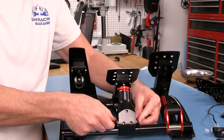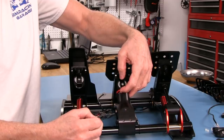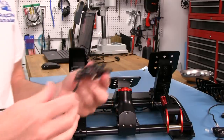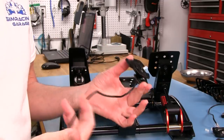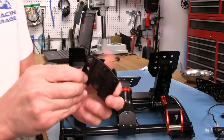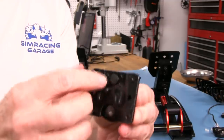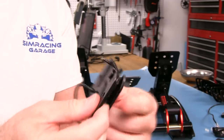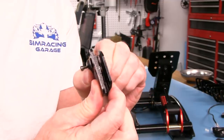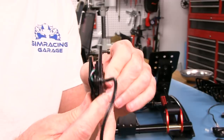Now I'm going to slide this whole assembly out of the load cell assembly - and look at that, it's very easy. I have to commend Fanatec for making this a one-piece unit that looks to be very easily serviceable. So if this goes bad, they can send you another one and you can just slide it in there. Taking a closer look, we can see the load cell in between these two steel plates - they've been riveted. One end of the load cell is riveted to one plate, and the other end to the other plate. When you put pressure on the brake pedal, it pushes on this plate and bends that load cell sensor. There's the wiring going into the load cell.